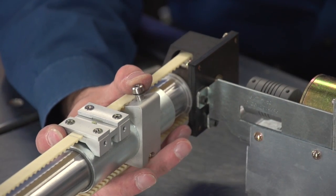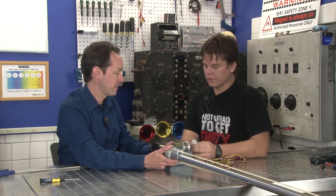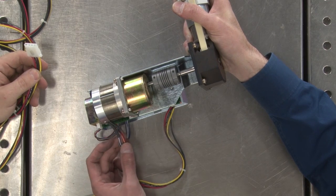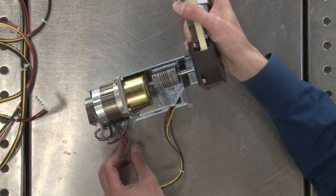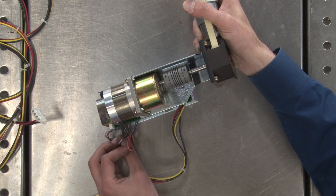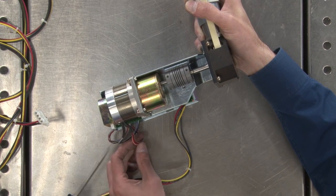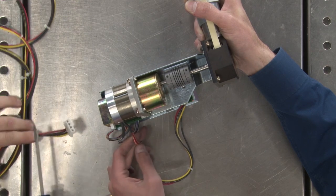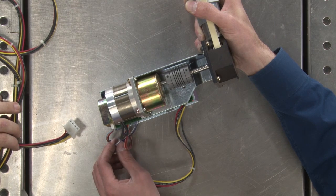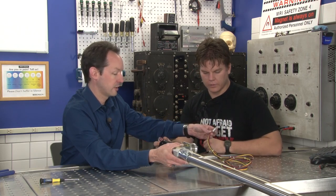Now, these are going to be rotary encoders. We've got the wires off the back. And this was just powered off one of the Molex connectors on the back. Yeah, so coming off the motor, we've got a couple wires here. So these are going to be encoder data there. Though I don't know, these are big wires. I've got three big wires, a bunch of little wires, and then a handful of wires here. So this could be power to the motor. And if there's three wires, then it's a simple three-wire brushless motor. And this could be an encoder for one thing, and this could be an encoder for another thing or something like that. I don't really know. But the only wires that go to this is this. It is the Molex power, yeah.